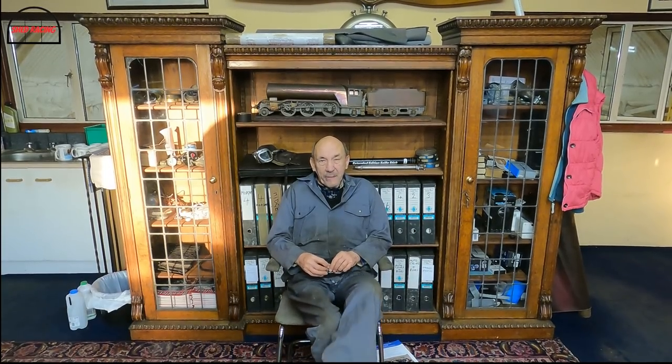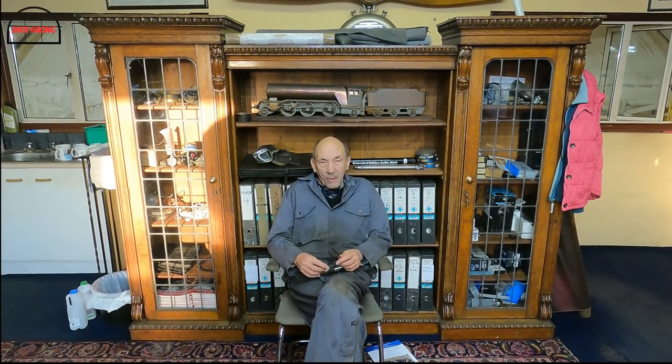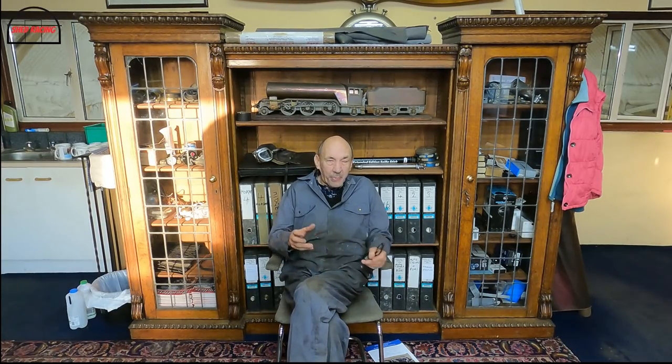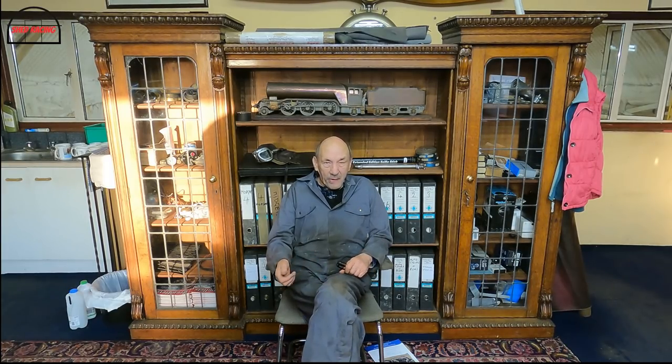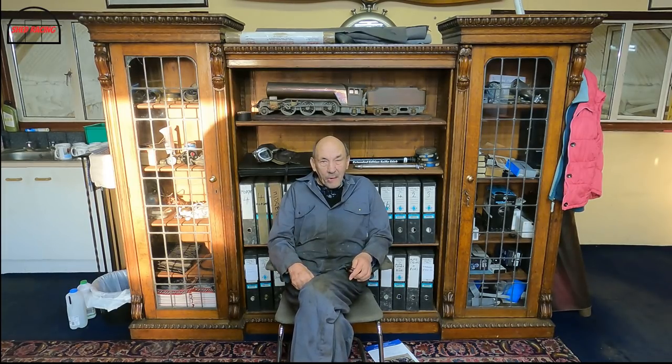Right, so it's a bit of a jiggle getting it in the car, putting the flywheel on and nonsense like that. But anyway, we've got it all together. The engine's in the car, and we put the barrels on. Quite funny, really, because we've got a ring compressor kit that we never use because it's always got the wrong size. And needless to say, it was the wrong size for the Hall-Scott. But John welded a little bit in, and it worked like a charm. The barrels fell on, so that was good.